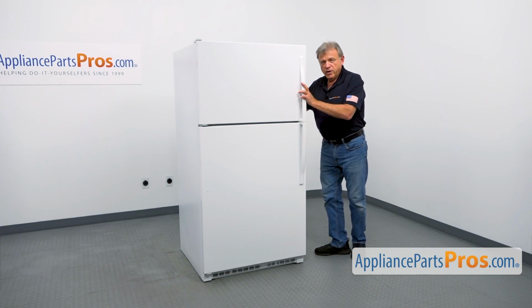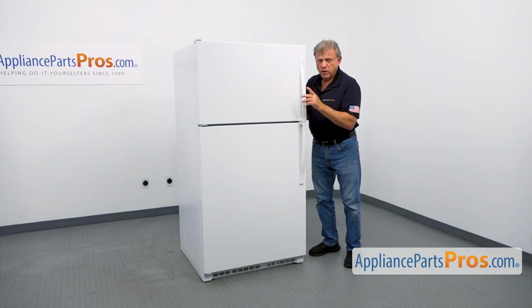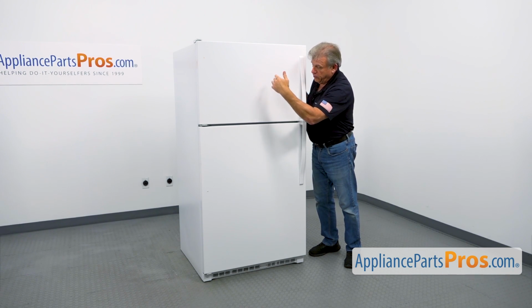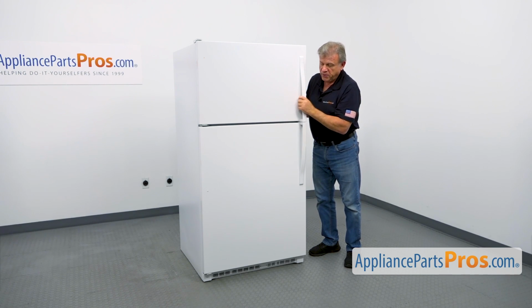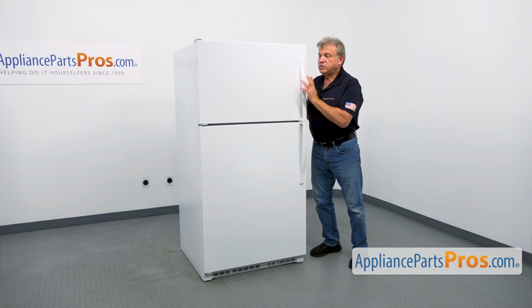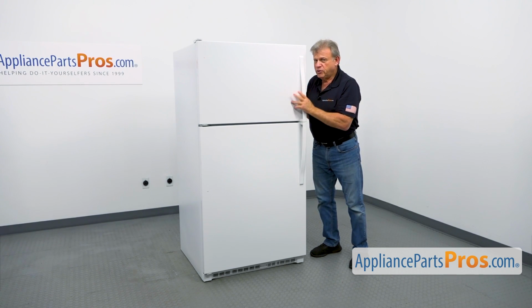Alright, so now we are facing a little bit unusual task. To get to the part, we need to tilt the fridge to the left if you're looking straight into the fridge, probably about 30 to 35 degrees. So it's very important when you're going to tilt this fridge to the left: don't do it by yourself.